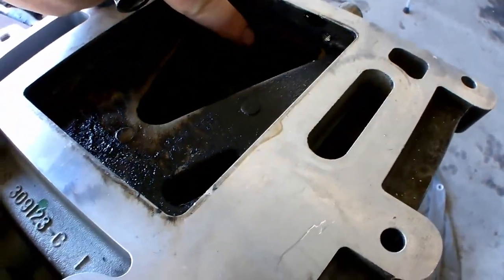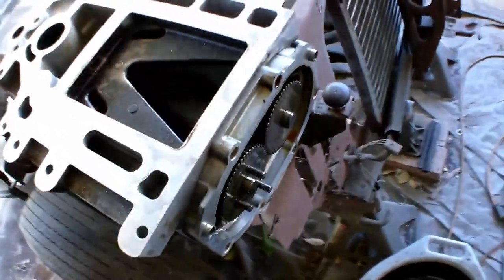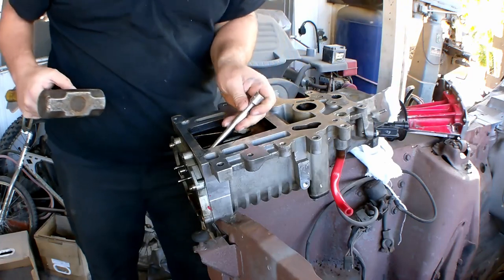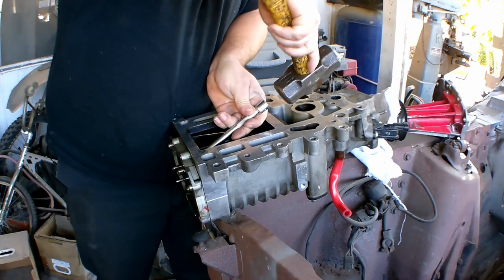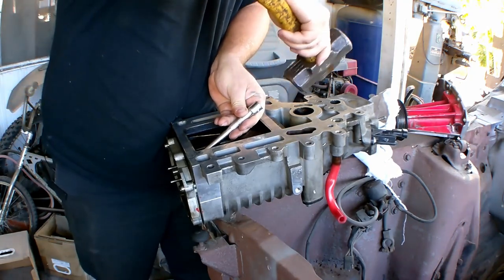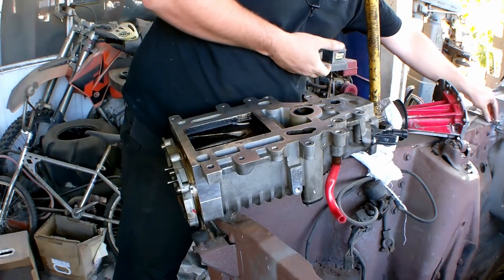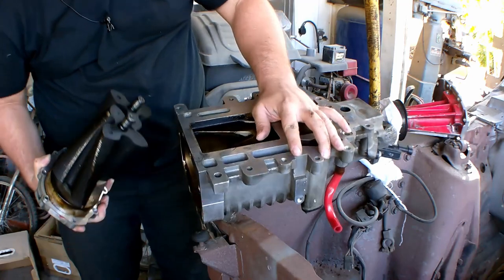You see back here on this wall, that's where you want to tap it. You don't want to hit the blades or anything — you want to push on the casing. I repositioned the camera so you get a better view. So you just put that in there and voila, just like that — just pop that out of the back and you can slide it right out.